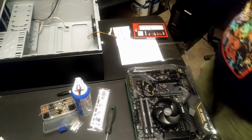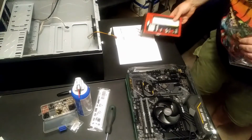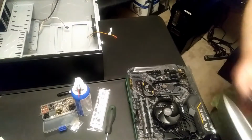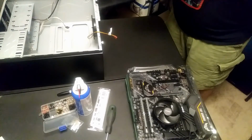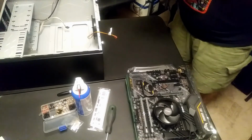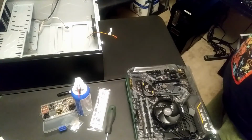So the next bit is to, well, before I do that, I want to figure out which slot I'm supposed to plug that fan into, because I'm seeing what looks like 4 fan plugs, and I don't want to just plug it into the wrong one. The computer can sense it if you put it into the wrong one, and it's empty, and the computer will not turn on. So I'll be back after I've done that, and then I will be installing it into the case.